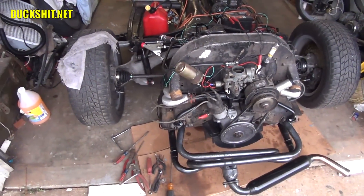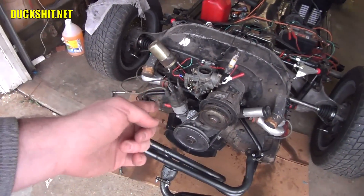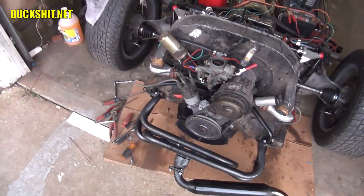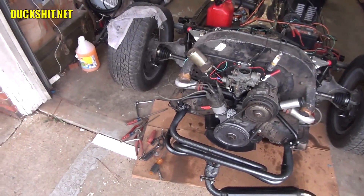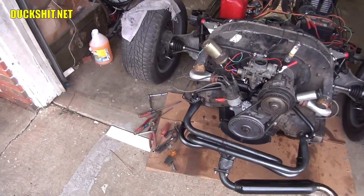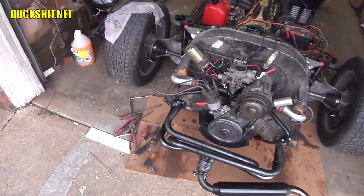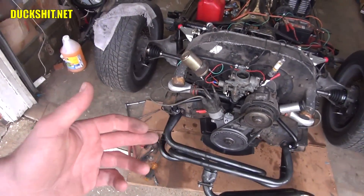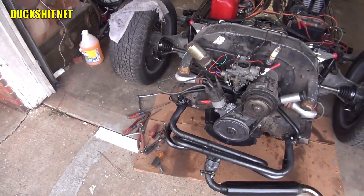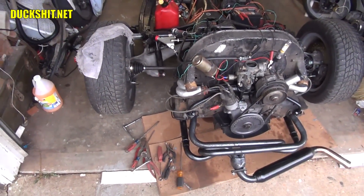I seem to be having some other issues. Somebody brought to my attention that I maladjusted the accelerator pump. That can be tricky because the plus and minus shown on the little label or screw can be deceiving - plus doesn't mean more pump, it actually means less. So I adjusted it wrong. Usually I leave those in the middle, but everybody had been telling me to max it out. I maxed it out to the plus, which way overdid it. He said put it all the way towards the minus, and it made a huge difference. I fired it up and was able to rev the engine up, which I was not able to do before.